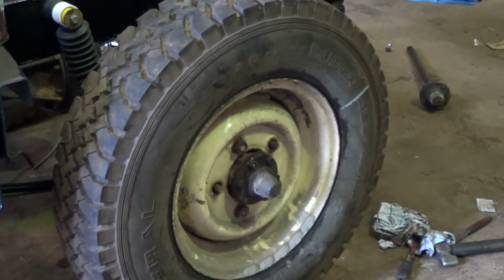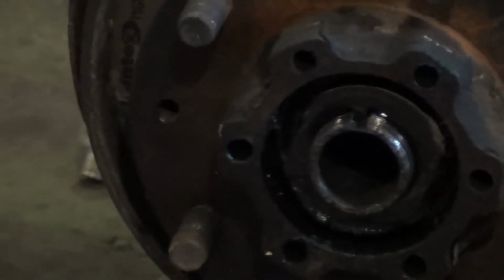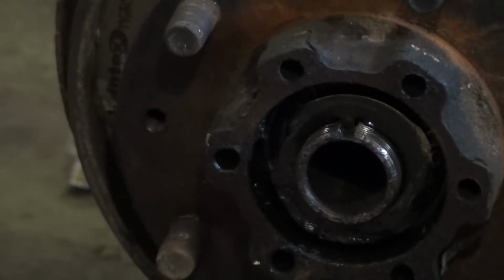I hope. I was going to point out that if you've just bought a vehicle and are using it on the road, it's worth checking these bits, because the locking washer had not been folded over on that side, so potentially the whole wheel could have come off. I never knew that because I never checked it, but if I'd checked it I would have rectified the problem.